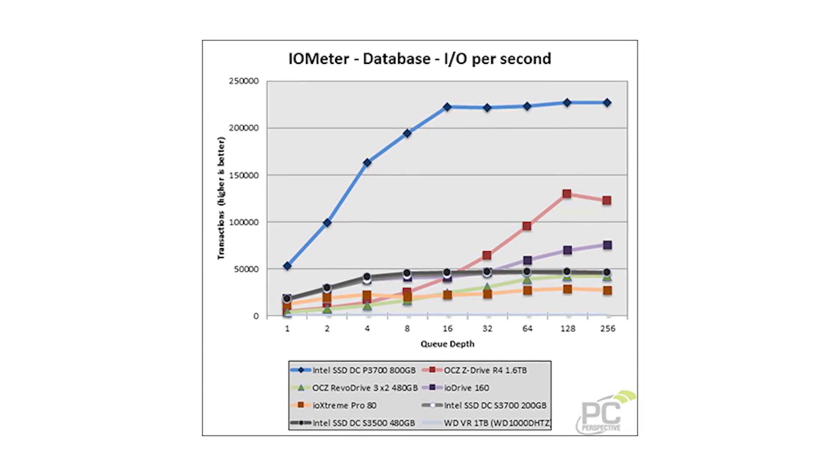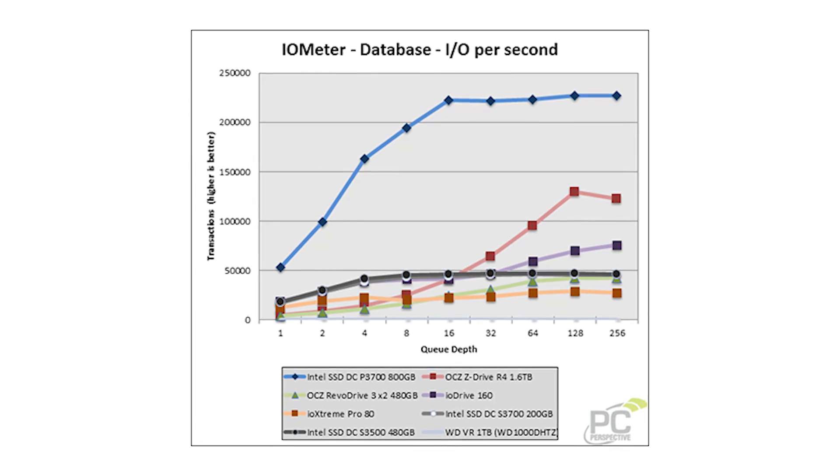That's an increase from 32 to 65,000. But what's funny is that this drive is so fast that we have a hard time even getting the queue depth past about 32 — it's servicing requests for data so quickly that the queue depth can't build up, even with very small reads and writes. For a single thread of IO Meter, which we used for quick preliminary testing since we only got this drive about 14 hours before publishing, a single worker peaks out at about 220,000 IOPS.